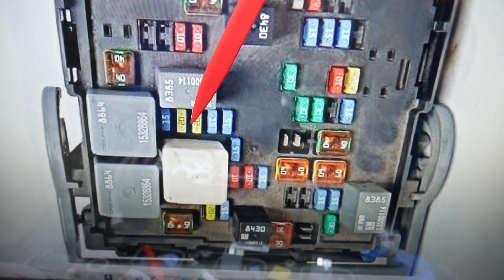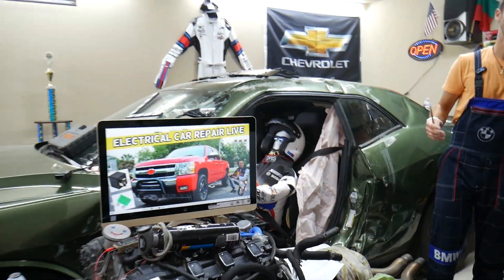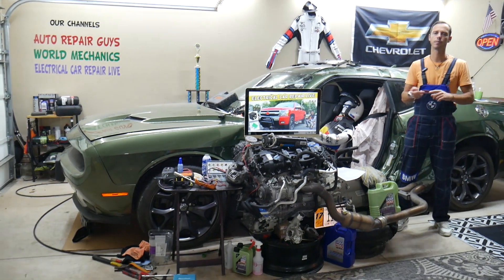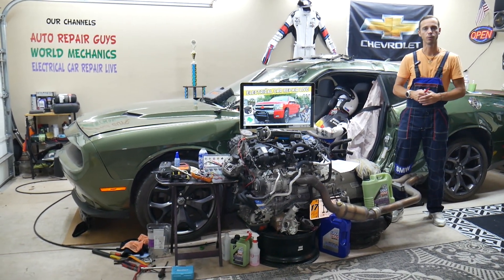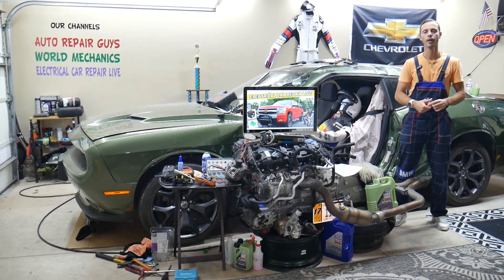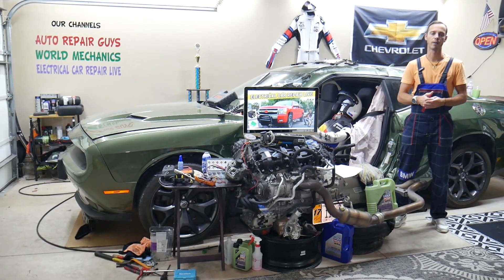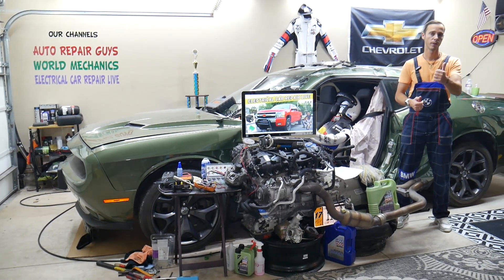Other things that can cause the headlight not to work: it could be a bad bulb. Always check fuses and the bulb first before doing anything else. If both of them do not work, it could be a bad headlight switch. Always check the wiring harness behind the headlight as well — sometimes when people replace bulbs they may not push it all the way, or you may have water or rust building up in there if you drove in really wet, muddy conditions. Hopefully the video will be helpful — see you guys next time.